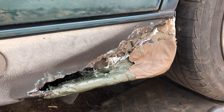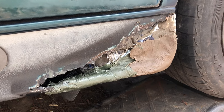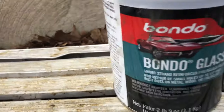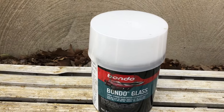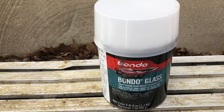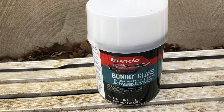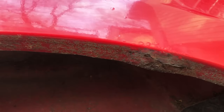This can be used when we have a large area that's missing a lot of material. Bondo Glass comes in two types: short strand and long fiber. The short strand — which is the one we have in front of us — is capable of repairing holes that are no more than half an inch. For example, if you sand a rusted area you'll have some holes there, and as long as they're not bigger than half an inch, you can use the Bondo Glass short strand type.